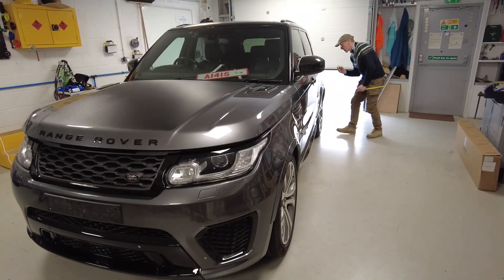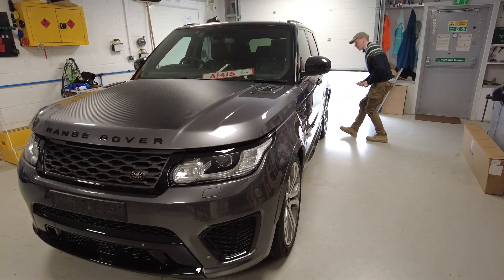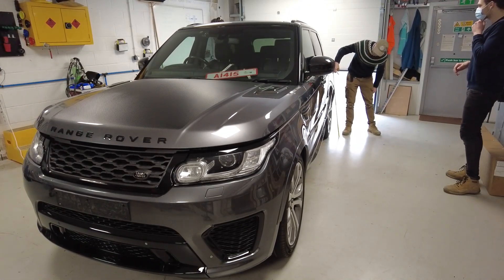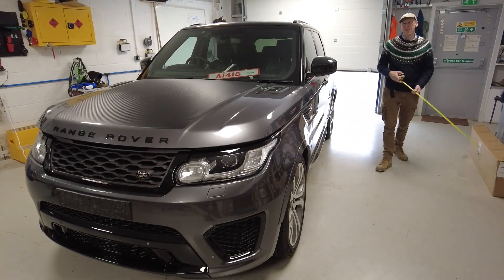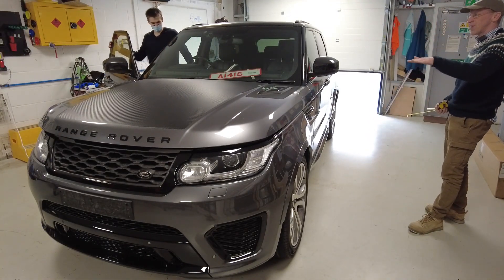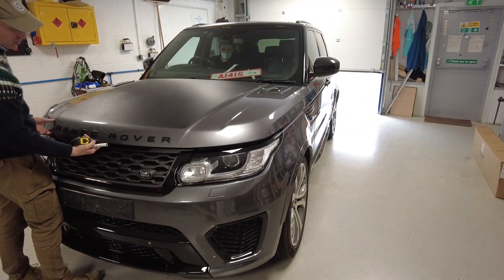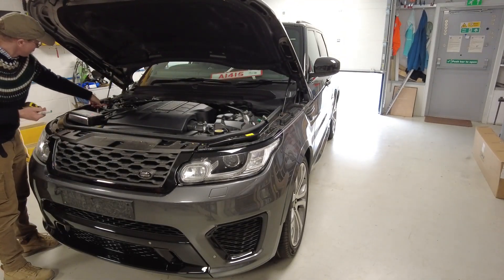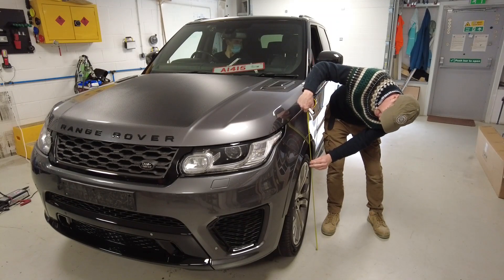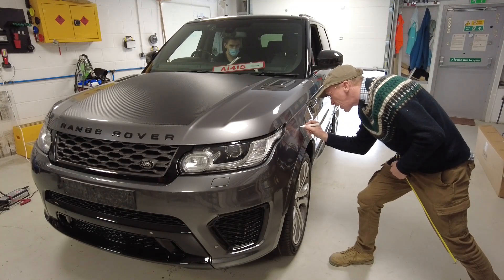Access mode default reading: 81 centimeters at the front. At the back we're at 800. Bear in mind, when you park your car it does by default go into access mode, so the default here is 810 front, 800 rear. Now we're going to put it in normal height — that reads 850 at the front and 850 at the back as well.